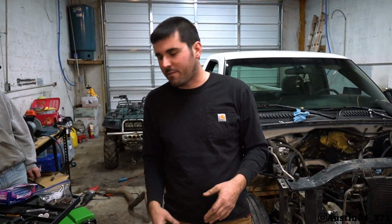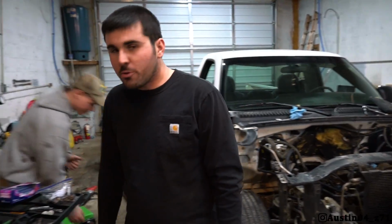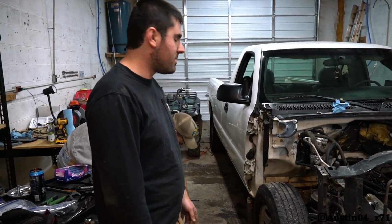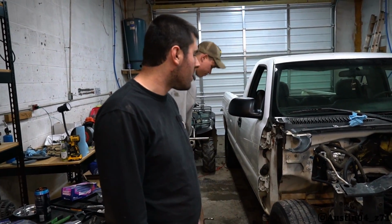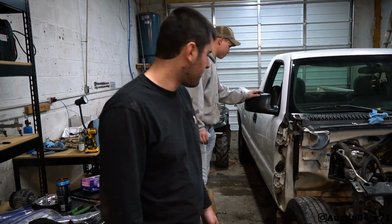If you restrict it, you can also hurt your horsepower, and that's why people talk about gaining 10, 15 horsepower out of dual exhaust, because you get rid of that factory one wide pipe and the muffler and stuff like that. But we're doing the long tubes and straight pipes when we go back up, and I'm getting ready to pull the cats and everything out of it too. We won't have catalytic converters this go around on it.